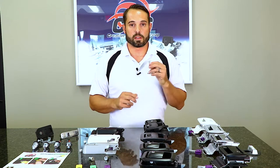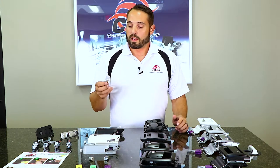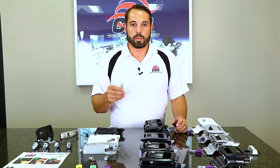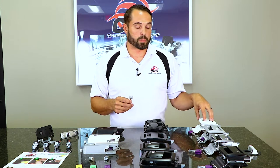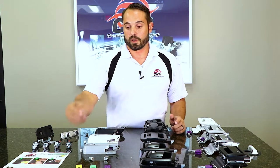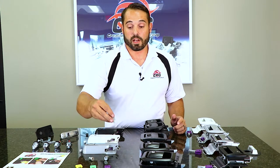When you see these at the dealership level, this is an indication that the lock can be re-keyed to match your entrance door using one of the purple G-series keys, which the dealership with this yellow change key should be able to change out really quickly for you.